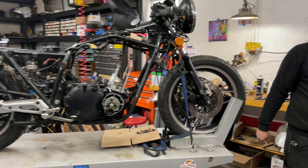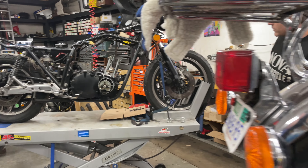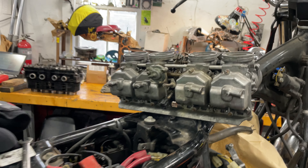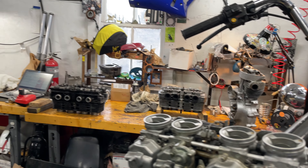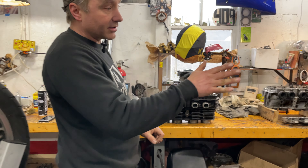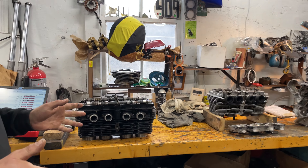The 1100 is actually early 80s, but it's designed really similar to what they did in the 70s. We thought we might just point out some cool differences in how the motors are laid out. They're both inline fours — both what became known as the universal Japanese motorcycle, which is just an across-the-frame four-cylinder overhead cam of some sort motor.